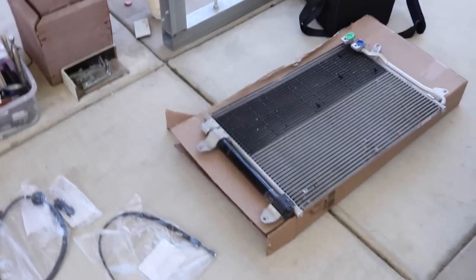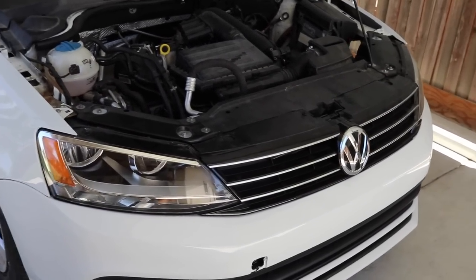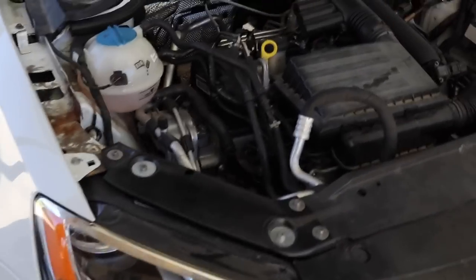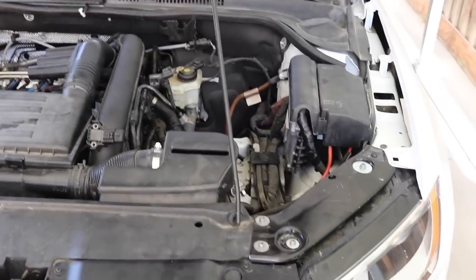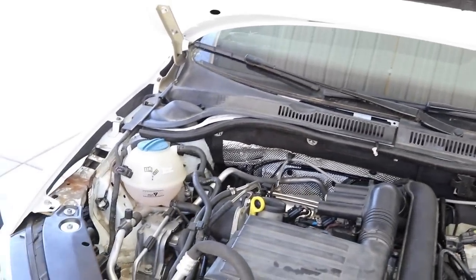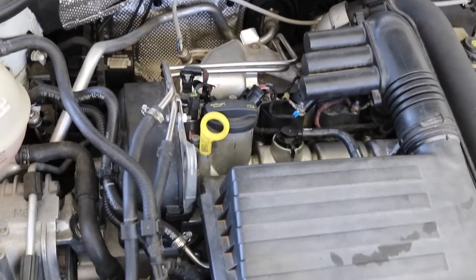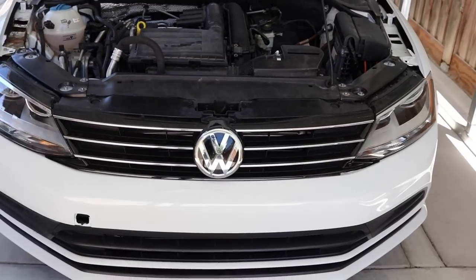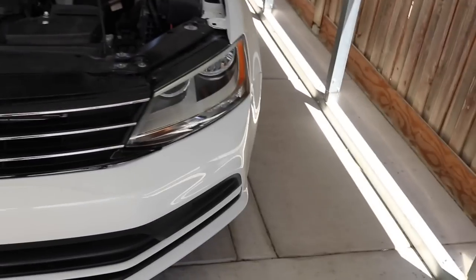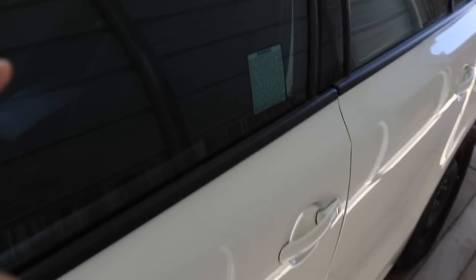I think that's pretty much it for mechanical stuff. I currently just have distilled water in the cooling system with a hint of antifreeze. I'm probably going to dump that and put in distilled water first, then add Volkswagen-approved coolant so everything is done correctly — they're very picky about coolant on these vehicles. I'm also waiting for the seatbelts to come back; I'm getting them rebuilt.